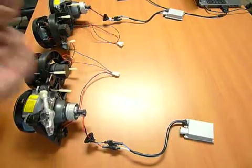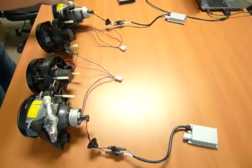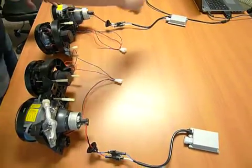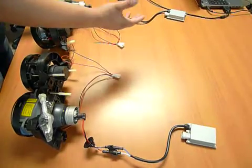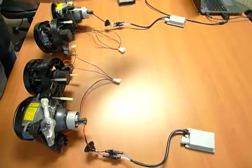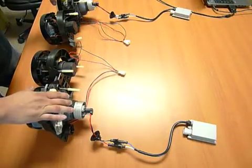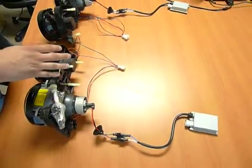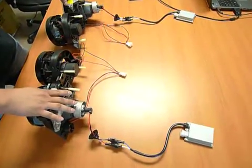However, if you turn on the low beams again after switching the components, and now the problem is on this side, that lets you know that this ballast is the cause of the issue, and we'll also be glad to work with you and get that replaced for you under warranty, as you are entitled to. So that will essentially sum up the cross-referencing test that will need to be done for the low beam issue.